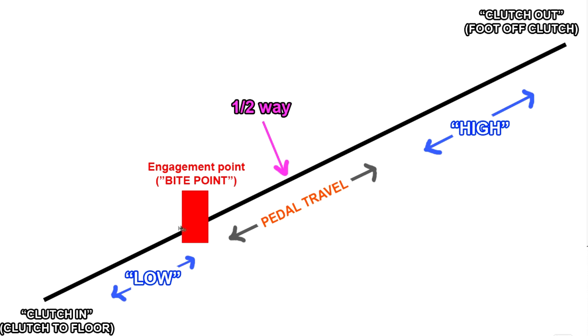So this is the part that is pretty hard to learn. You got to bring your clutch foot up to this point, hold it, car starts to roll, then you can bring out your clutch pedal. When you do an upshift clutch release, you bring it up to your engagement point, hold it for a second, then you can bring it out. One step, two step.